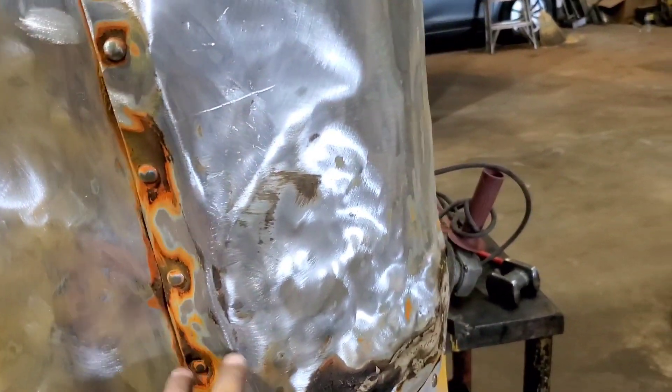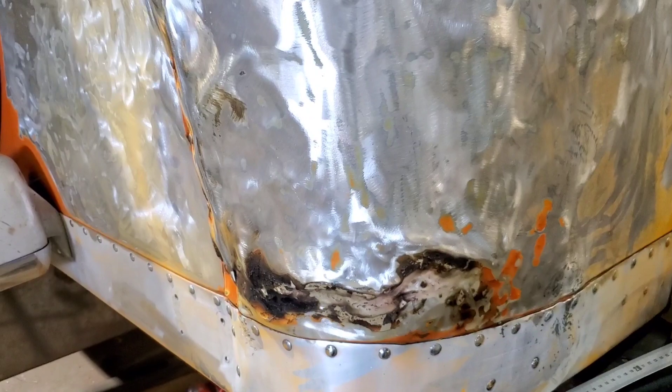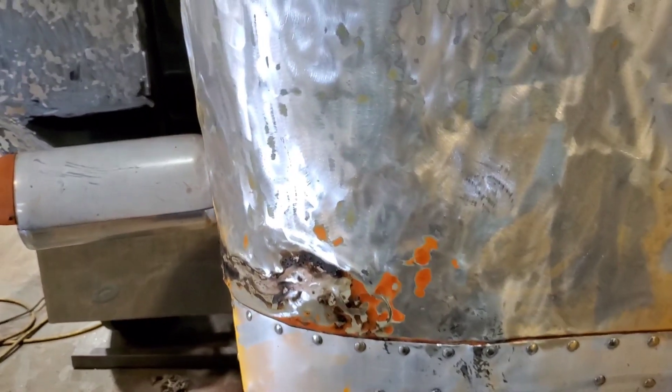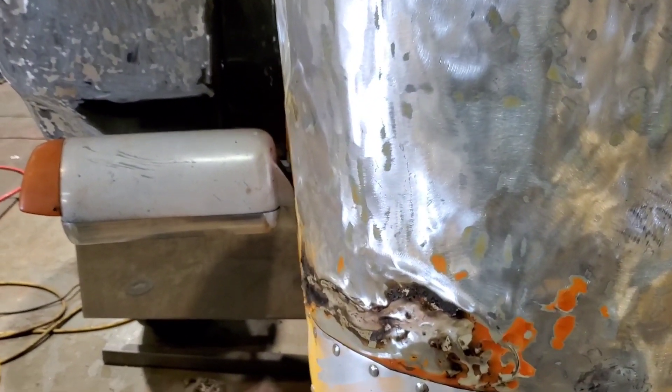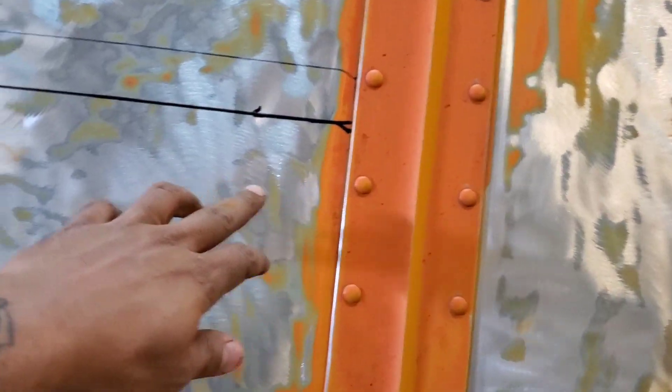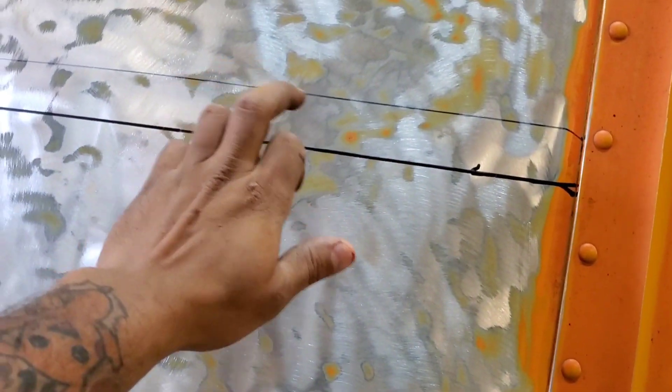I don't like the way that this is going to form up. We've got a couple tears here on the metal, so I don't like the way this is going to come out. Honestly, I might just cut this piece out, and that's what we're going to do. I made a line here where I'm going to cut, and what we're going to do is sand these rivets down here, and we're going to cut out this section and pretty much replace this little piece of panel.